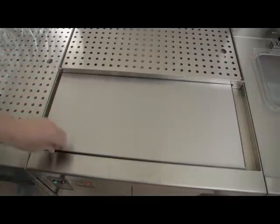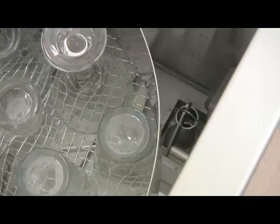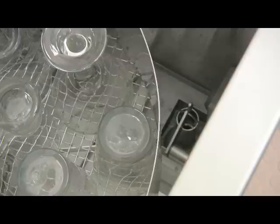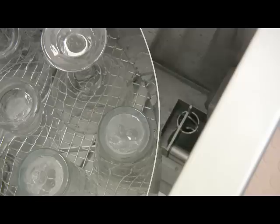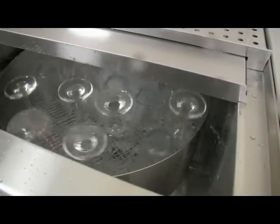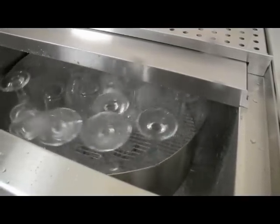To run a cycle, close the sliding cover and press the start button on the control panel. Water from the hot water supply line will start entering the machine. The drain may delay closing for up to 15 seconds if hot water is not sensed. When hot water is sensed, the drain stopper is automatically lowered, the tank fills with water, and the detergent pump begins pumping detergent into the water. During the wash cycle, the glass rack rotates inside the machine as a mixture of water and detergent is sprayed out of the spray box onto the glassware.